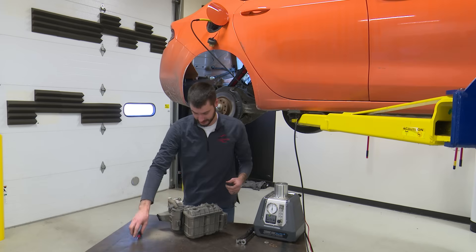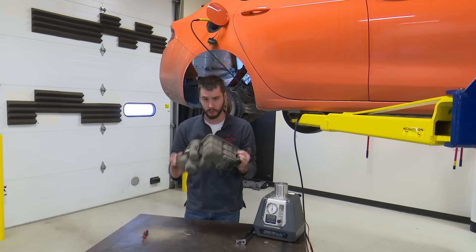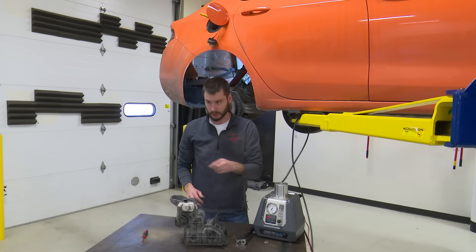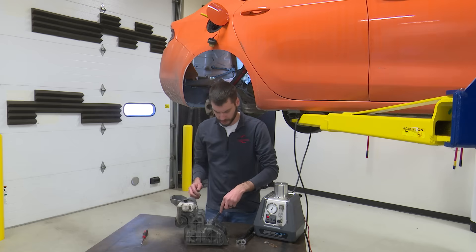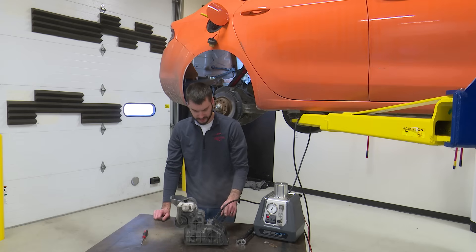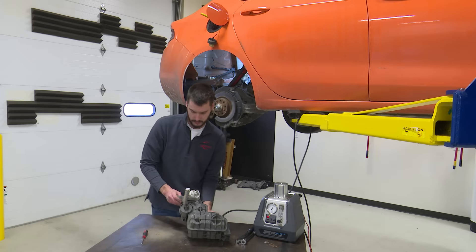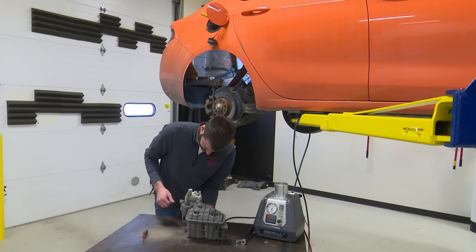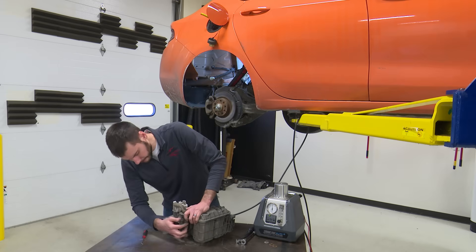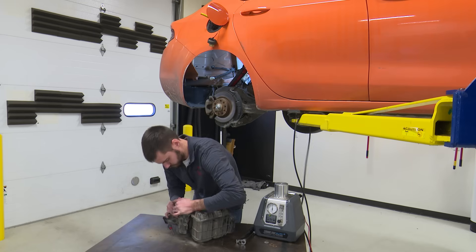Wow, that's a lot of stuff built up inside of this thing — just from removing it and tipping it here. That clicking sound means the weights inside the ESIM are moving. I'm going to take the smoke machine and bench test this. A lot of smoke coming out. Going in through the port that would be coming from the gas tank — we got it actually flowing through the canister. I'll plug this up and it should be smoking out of this vent right now. I see a little bit, but not a ton. Let's disconnect this hose.